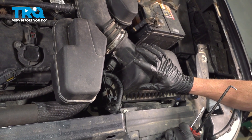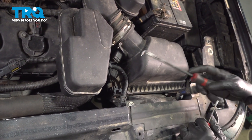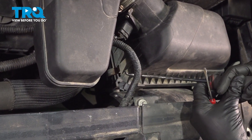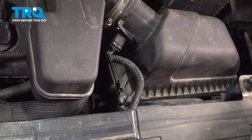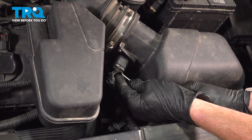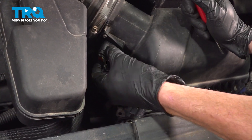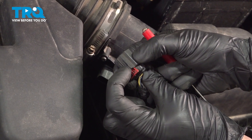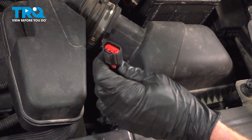Up inside the engine compartment, we're going to start removing the air filter housing and the air inlet tube. We can use an angled pick to dislodge the wiring from the air filter housing. Continue on to the mass airflow sensor. Along the bottom of it, you're going to find a red locking tab. Squeeze on the locking tab underneath and gently pull this out of place. Do a quick inspection for corrosion and set that aside.